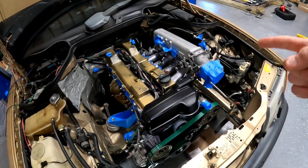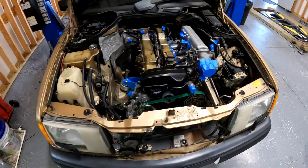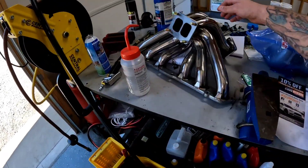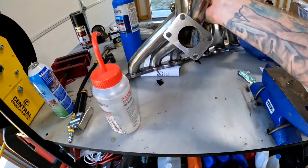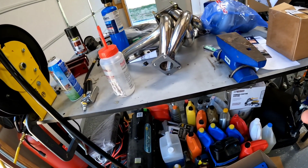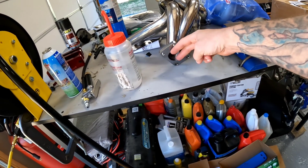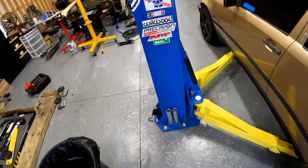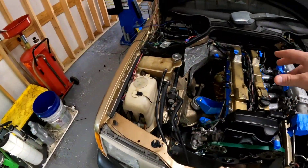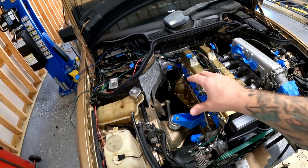I've got the fuel rail coming, and the wastegate coming. I need the wastegate because I can't use this exhaust manifold as-is from eBay — it's got the old school HKS-style fat flat flange four-bolt wastegate style. So I went ahead and got a 44–45mm wastegate with a modern style flange that I'm going to weld on. I also have the precision turbo oil feed and return fittings coming. Once I have all that, I can go ahead and mount the exhaust manifold, wastegate, and turbo.